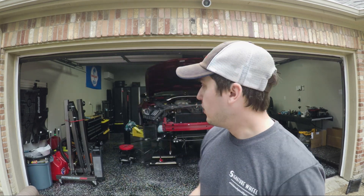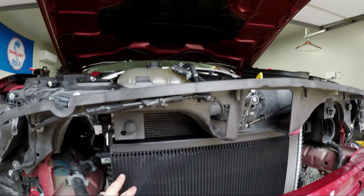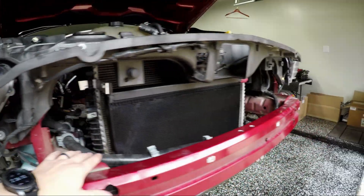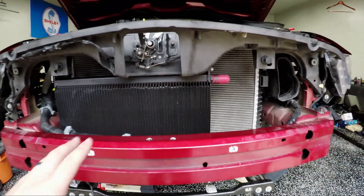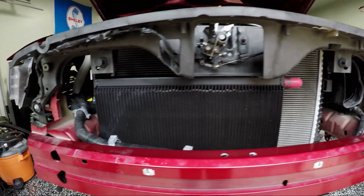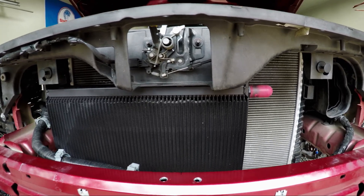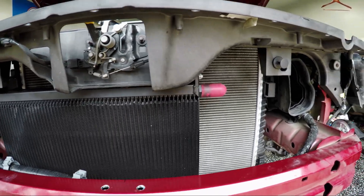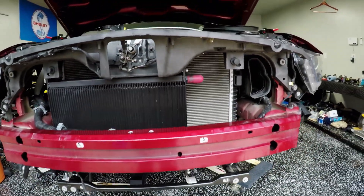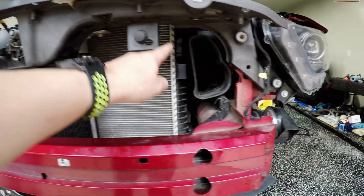With the new setup on HB, our new oil cooler is separated from the radiator, and it's off-center. If you actually put it in the center of the radiator area, the OEM ducting would actually work. The problem is without some additional fabrication, air could go around this oil cooler and into the radiator, so it'll be less effective for the oil cooler itself.